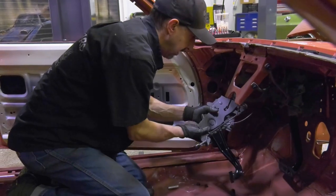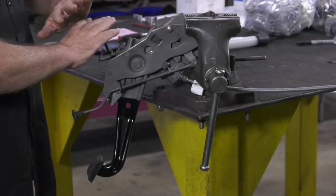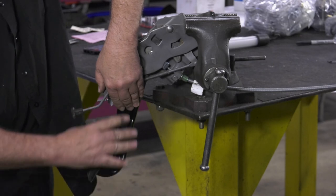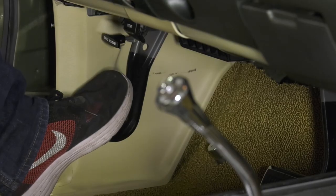Right now Dave is installing the emergency brake or park brake system in our 1968 Dodge Charger. Rather than stop him in real time, we've simulated the exact same parking brake system over here so you can see how it works when it's actually in the car. My trusted understudy cousin Dougie is going to help me show you how this works. If this unit were actually mounted in your car, all you would see from underneath the dash is this lever — which is why it's painted black. You'd stomp this pedal down and that would engage the parking brake system.